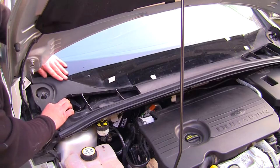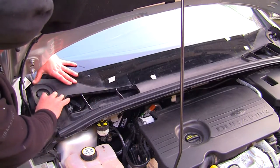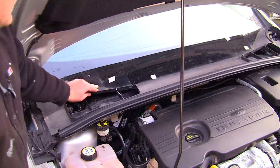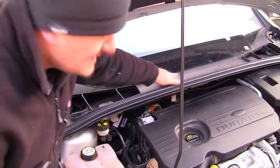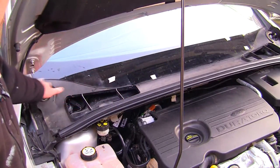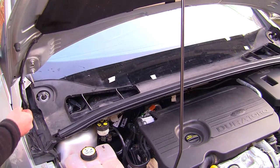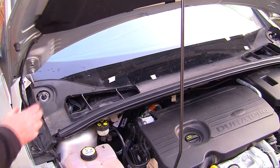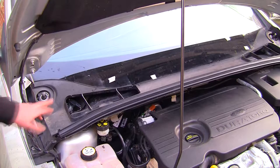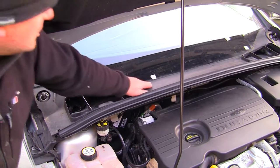I mean, I'm no mechanic at all, but if you're wondering if you could do this job, you can. It's not too difficult, really. It's only four bolts, and then that's it, really. You've got to get the wipers off, which is a bit of a scary thing, but as long as you don't try and do them with a spanner and move everything as you're undoing it, the idea is if you zip them off with an impact tool, then nothing moves, because it's the speed of the actual nut coming off that means this part doesn't move. So I'm going to spend a minute just making sure that's nice and tight.